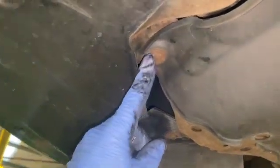Now we've just got to get the under tray off — very straightforward job. There are 10mm bolts all around the outside and across the front, three across the back, and one along each side. There is one Torx 30 in the middle as well, so you'll need a Torx 30 to get that out. We'll just whip that off and get the under tray down.